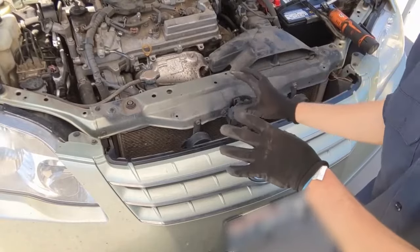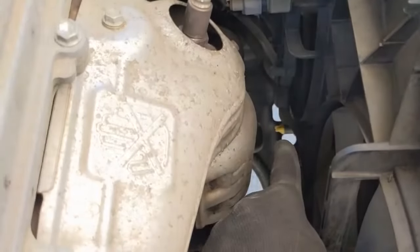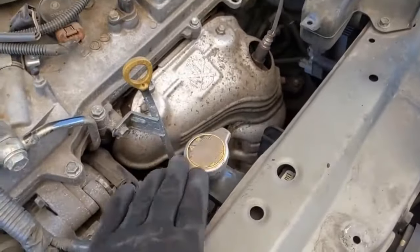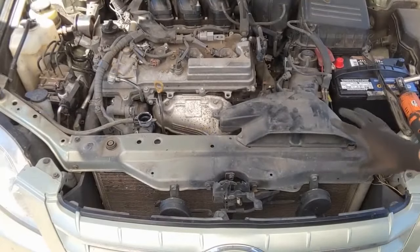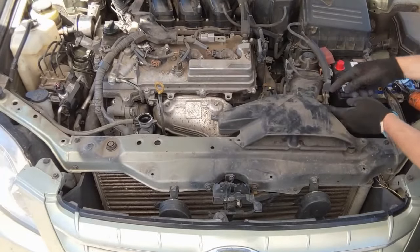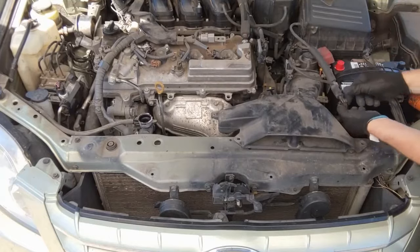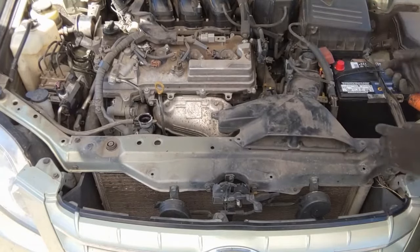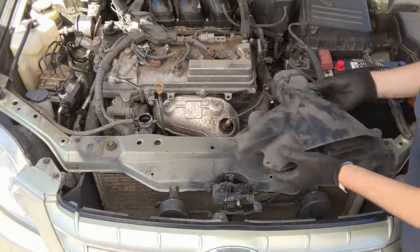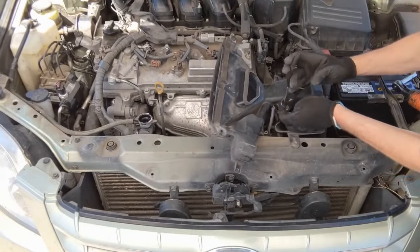The factory method — and the way we're doing it on this vehicle — is by draining the coolant. Right down there is the coolant drain plug. Unscrew it, have a catch pan underneath, and let the coolant drain. Opening up the radiator cap will help speed up the process. There are hoses over here that come off — you can pull the hose from its holder or pull the holder out by pinching from underneath. Same on this side, pinch from underneath and disconnect it. Underneath, get a pair of pliers, just pinch it together and it'll fall out of its hole.